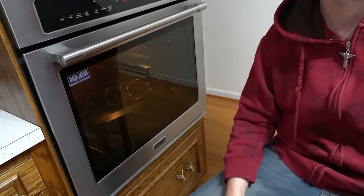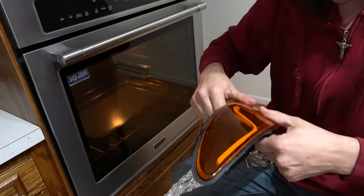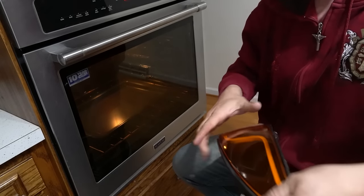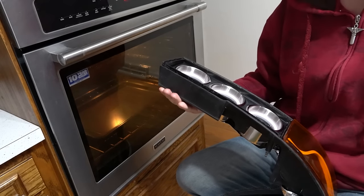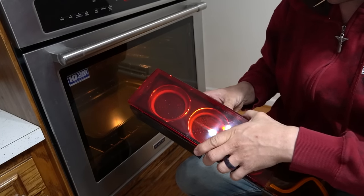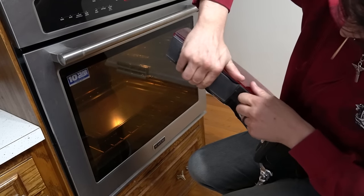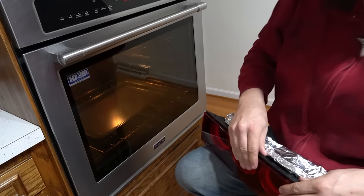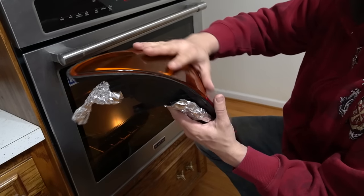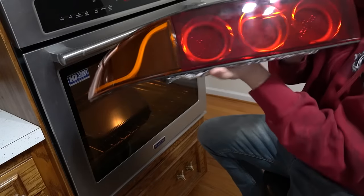Alexa, 7 minute timer. 7 minutes, starting now. Ooh, that was a good pop. Nice and seated in place. All right, the corner's on. Make sure everything lines up in the correct spot. And it is all together. So, one last thing I'll do while the Butyl is still hot is I will clamp these edges until everything cools down, so that way it doesn't accidentally back off. But that's the final piece.